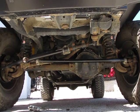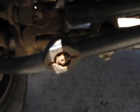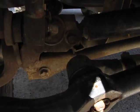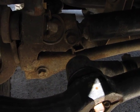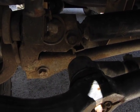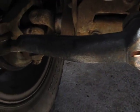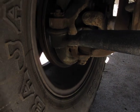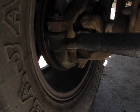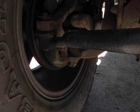I'm going to get up a little closer, and while my helper turns that wheel back and forth, we can see pretty clearly that when the tie rod moves, the steering linkage is activated and everything moves in unison. Going to the knuckle — there's zero play, zero movement in there. No up and down, no side to side without the knuckle actually moving.